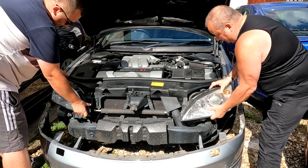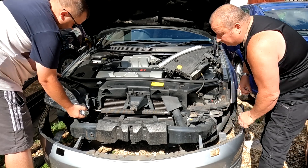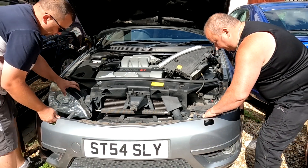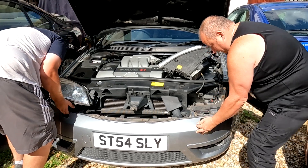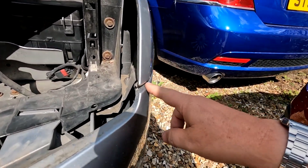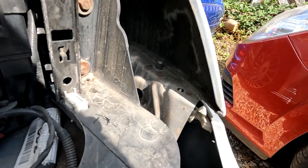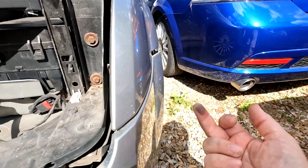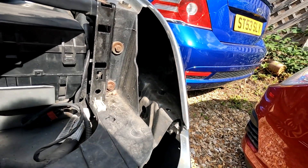You can just lift the headlights out of the way, just to ensure that these clips go in correctly. It goes in there now — there are three bolts along there where you've got to come up from the inside of the wing at the back. That's why it's just easier to have that open so you can see if you're screwing in all right.